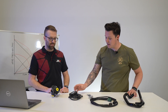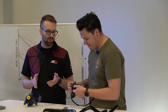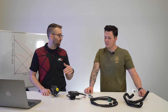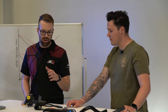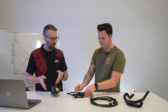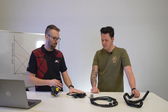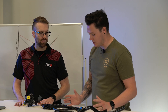There's also a coolant pump controller on the table here — what do we need this for? The factory pump uses a 2 Hz pulse width modulated signal from the ECU to control the factory pumps, and this pump doesn't accept that kind of signal. So this is a translator: it intercepts the factory signal from the ECU to the factory coolant pump and converts it into something that this pump can understand — that's how you get this thing to work. It also has fuses integrated on it, so you don't have a fuse hanging out in the harness somewhere. It's got the power cable that hooks up to the battery, so you've got plenty of power to supply the pump.